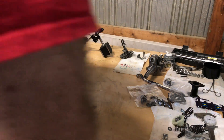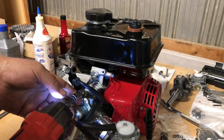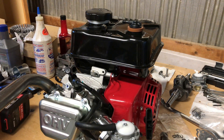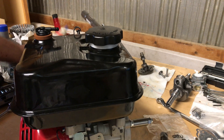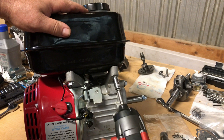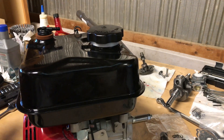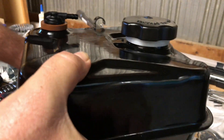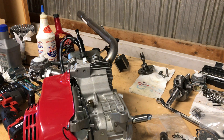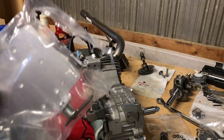Let's go back to the bench and install a fuel pump. I'm going to go ahead and take this tank out, but I want to try to keep the tank and still run a fuel pump — maybe hang one off the carburetor back here. The minibike this is going on doesn't have an external tank and I really don't want to trouble putting one on. I had thought about using a top plate and bought one off eBay, but there's really no sense in using it on this because I'm not going to need the throttle linkage or anything.